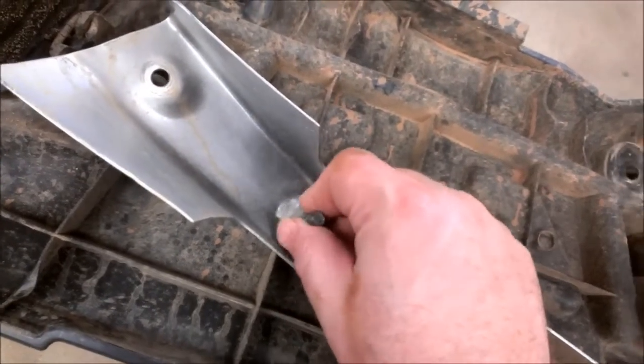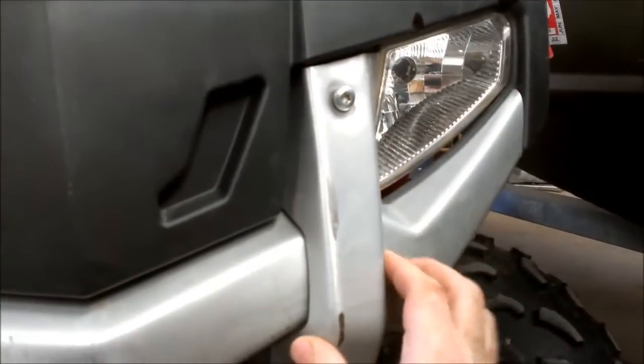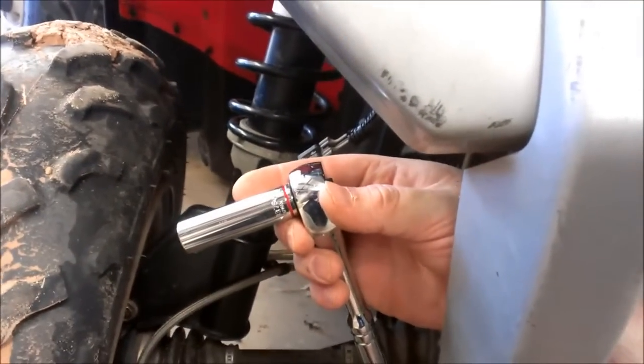Here are the studs I was talking about — they have the half-inch bolt back behind here. I've beaten this bracket out with a hammer. I'm going to see if I can get it to line back up, and if not, I'll be ordering a new bracket. I pressed it a little bit with a hammer for now. We're supposed to go out to Lake Murray this coming weekend, so I want to get it back together. The stud runs from the vertical part of the brush guard through the horizontal and through the mount — these are self-locking nuts, so you need to use a deep well socket because a regular depth socket isn't deep enough to reach over the stud and tighten the locking nut fully. I've got it usable — it's still sticking up a little bit, but not near as far as before, and the storage compartment will open now, so I'll pick up new parts I need later on.